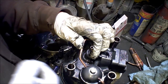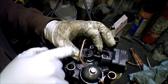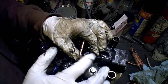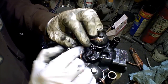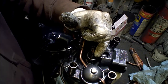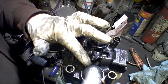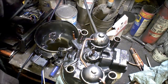The electric motor spins this, and as it spins, there is essentially a crankshaft or an eccentric on the motor, and it makes the piston go up and down and compresses the refrigerant. This right here is a tube that's bent that sits in the oil. The middle of the tube is actually centered, but the oil goes up in here a little ways, and as this spins it gets thrown to the outside, which pressurizes it and pushes oil up. The refrigerant is compressed, goes through, back up, along here, into this line that I cut, then out through the system.